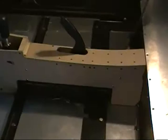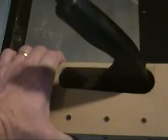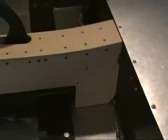I've done quite a bit more work here on the console. You can see I've got my little cover plate here — this is made out of quarter-inch MDF. It's all glued and screwed together, so this thing is really tight. I went ahead and locked this together and I'm still going to grind that off and make this a nice smooth transition. I came up here and built the front of the opening. I had to do some work on the shifter — I had to buy a short shifter kit in order to put the shifter right here in the center of this hole, and it works really good. It goes with all the gears. That's basically cut and everything fits pretty good.